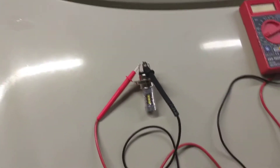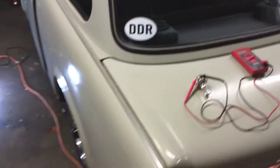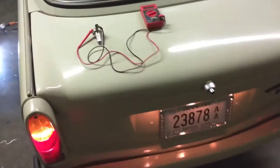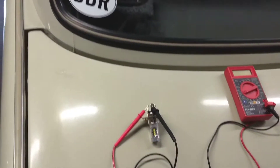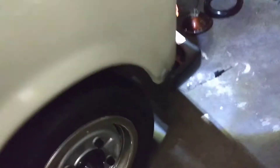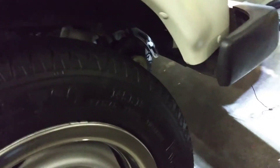I've done a lot of electrical work to this car, my Trabant. It's got a 6-volt operating system and I've put brighter headlights in it. I've got an AC Delco alternator with a 6-volt voltage regulator. Up under the dash I've got a little 6-to-12 volt converter box and a fuse box to power my radio and some other circuits.